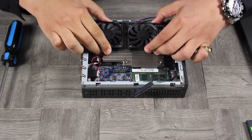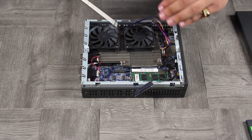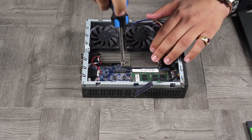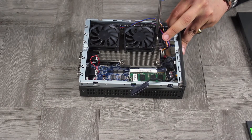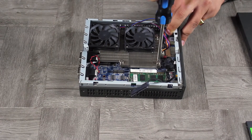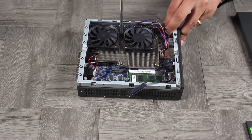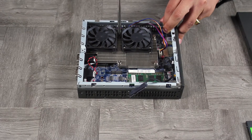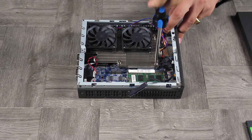Line it up and screw it down — again using opposite corners for even pressure distribution. Do each corner just a little bit first to gain some traction. If you're using a manual screwdriver it may require a little force since these are spring-loaded. If you're using a power drill, make sure it's lined up — you don't want to scratch the PCB, which could cause the unit not to post. Now just tighten all four corners.